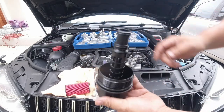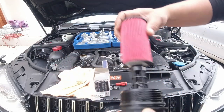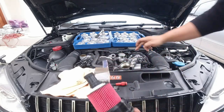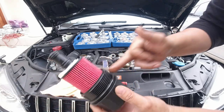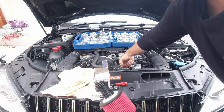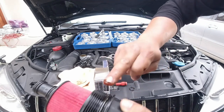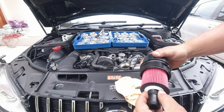There's always a rule of thumb when it comes to reinstalling this: you should always grab a little bit of oil and lube your rubber o-ring — old or new oil, it doesn't really matter as long as you've got some oil on there. Put it all the way around the o-ring. This is very important — if you don't do it, it can tear the o-ring and it won't seal properly and you'll probably get an oil leak. We'll now reinstall this, fill back in our oil, and we're done.